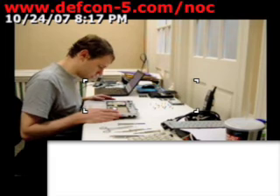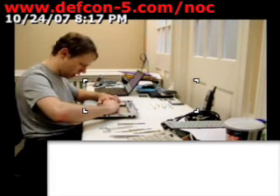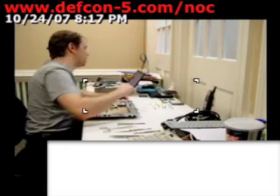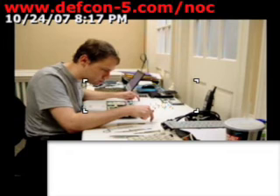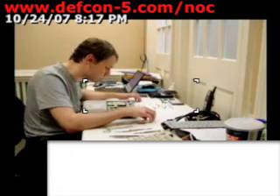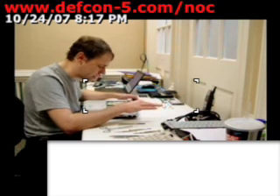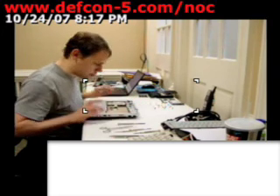Okay, you think you're halfway done, but you're not. Sometimes you've got another onboard stick of memory. If you're wondering why I have not grounded myself — the table is grounded, this whole surface is completely grounded, it is designed for this kind of work. The chair is also grounded, so just by sitting down I don't have to worry — I'm more than grounded.